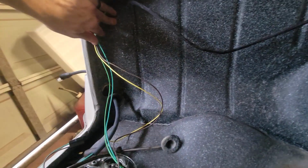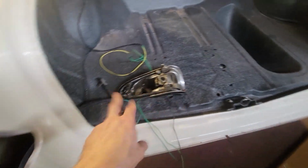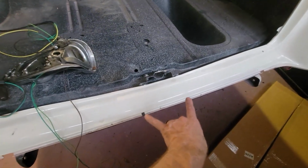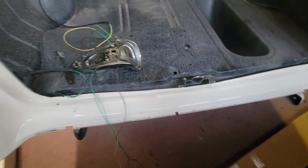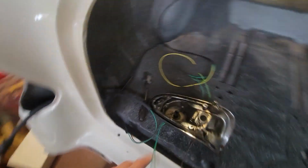So now that I've got this wire back here, I'm going to have to make a couple of splices, because only the left turn signal is the one that ends here. That's the yellow wire, and then the other wires are common, and they need to go to the other side. So they give them to you along, and I'm going to have to make some more of those solder splices here and then run to the other side and catch the other tail light. But you also have the license plate lights here that are on the vertical horns of the bumper. And then another thing I'm going to have to do is the backup light, which is going to splice, has to go through this same tube. So that's everything I've got to do now. This is getting really, really close. So let me continue on with this.